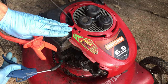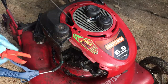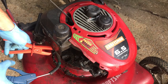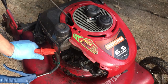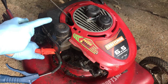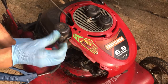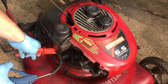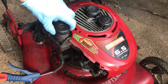See, it's coming out of here. So what I'll do is put this cap that came with it on, pressurize it, and clamp the line to show you what it does. All right, I clamped it — this tank is holding pressure and it shouldn't be. It should be breathing. I'll show you again: let off the clamp, pressurize it, clamp it — it's not breathing.